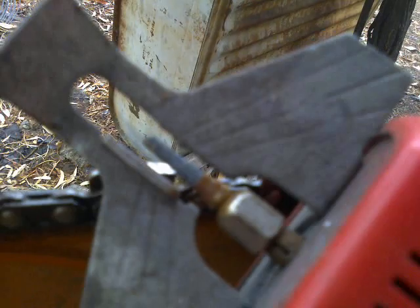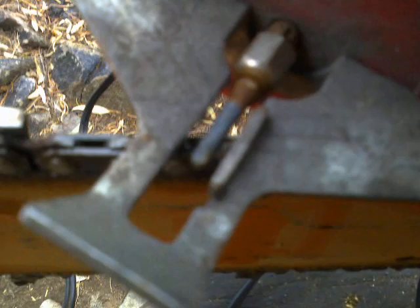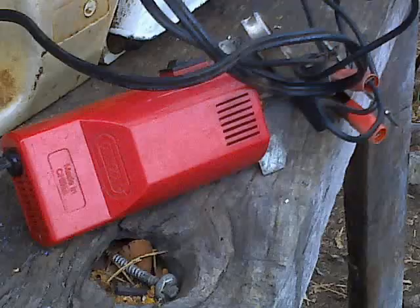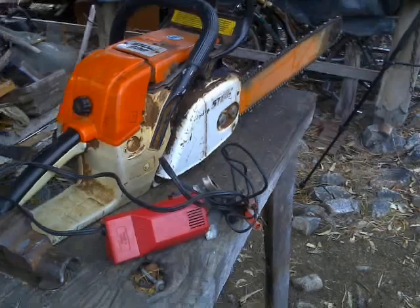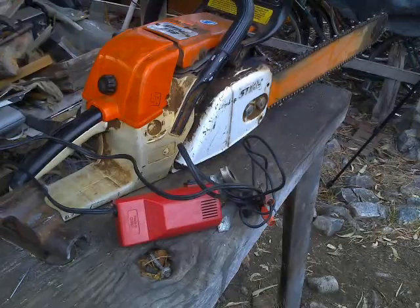And as your little stone wears away and gets smaller and smaller, there gets to be a greater and greater difference between the circumference of the stone and the desired profile of the cutter. So the older your stone gets, the worse your sharpening job gets. However, you can get pretty good at sort of feather touching your cutting edges by hand, and for, I don't know, probably 15 years or something, that's how I sharpened my chainsaw.